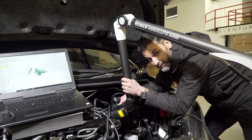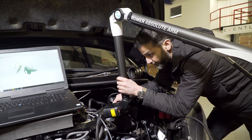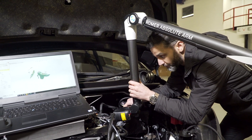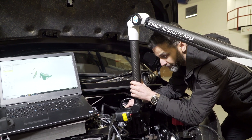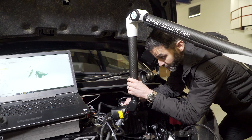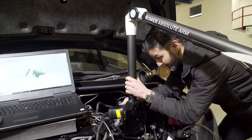I've removed the connecting tube from the airbox to the turbo inlet. I'm going to try and scan behind the engine to see how much space there is to increase the diameter of that tube. We need to take into account the fact that the engine moves back and forward under acceleration, so we still need some clearance between that tube and the rear heat shield.